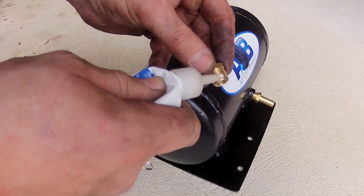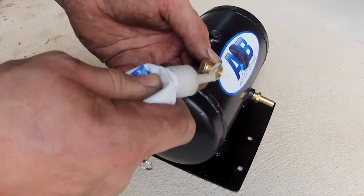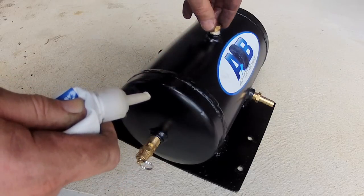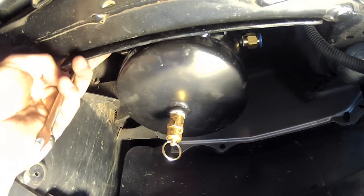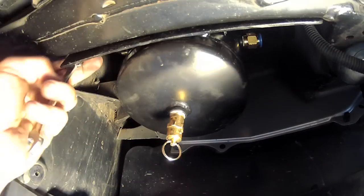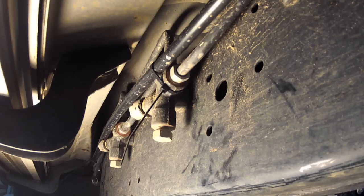When connecting all your air fittings, make sure you use thread tape or better still a quality pipe sealant to prevent air leaks and ensure you get a reliable system. The reservoir tank bracket bolts on inside the rear bumper using captive nuts provided in the chassis rail, while the airline is run out of harm's way with existing KDSS or brake lines.